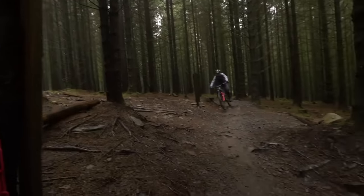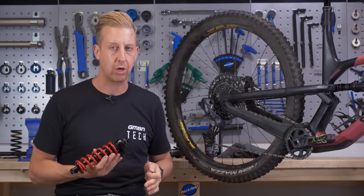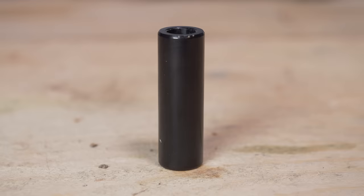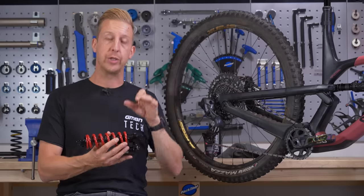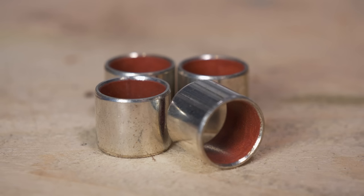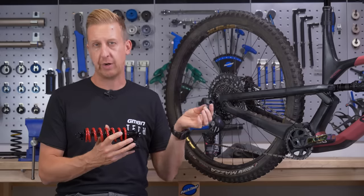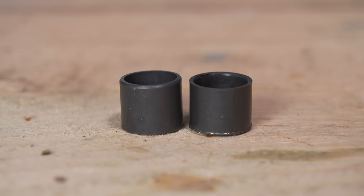Let's have a quick look at the tools and everything else you're going to need. There are various types of shock hardware available for every shock on the market — they'll all be slightly different depending on which frame they go to. You'll need to make sure that when you buy your shock, you specify the hardware you need, including the bushings that go into the eyelets of the shock. With bushings, there are three or four major styles: DP, DU, and then the low friction options.